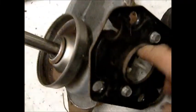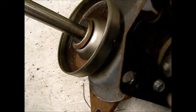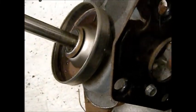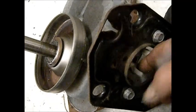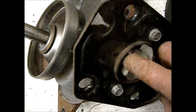I'm going to get some other transmission in here. Spinning this thing — it seems like it's agitating, but this transmission is binding up. It starts to agitate but doesn't do anything. So that's clockwise, and counterclockwise — nothing. There it is, it will agitate, and I don't know why it was locked up — that's what threw me. It does have some problem because it's only agitating, it won't spin. So it probably got locked up inside, and when I pulled it out it kind of theoretically sort of fixed itself. But yeah, that's the old one.